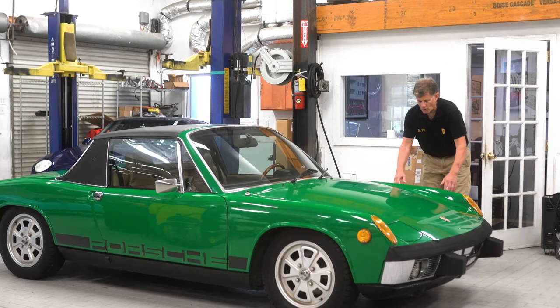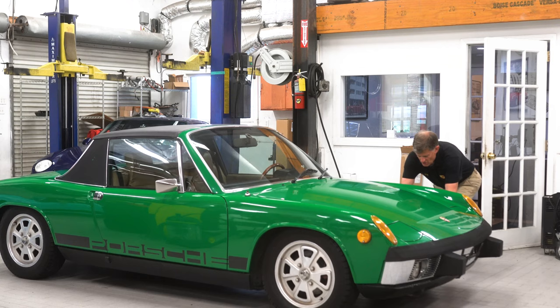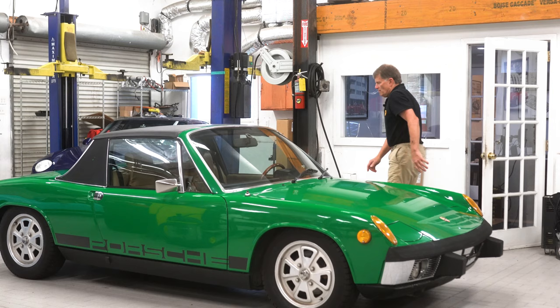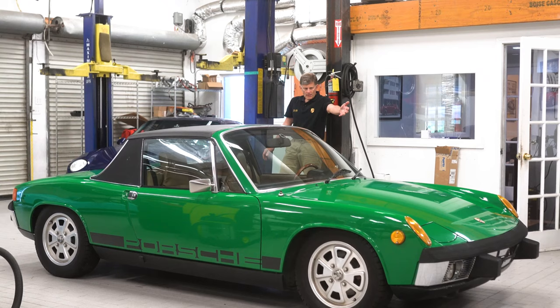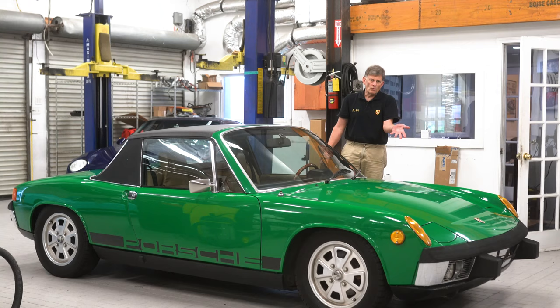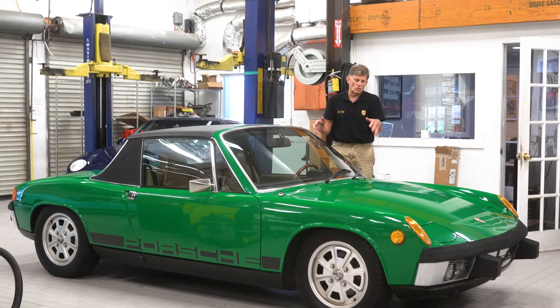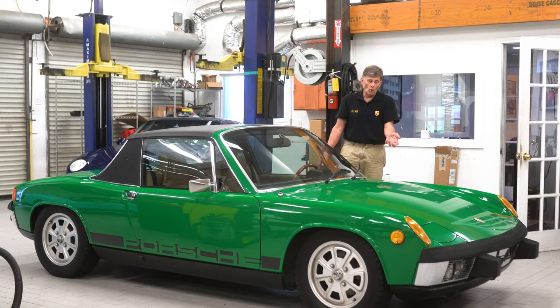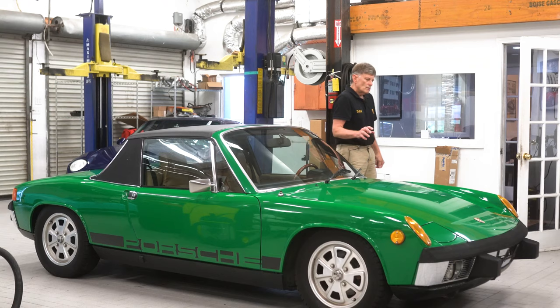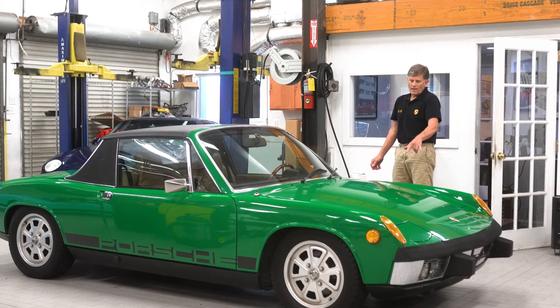I'm going to grab the tire and wiggle it, watching the sidewall flex as well as seeing if there's any wheel bearing play. If there's wheel bearing play, the wheel will knock as you roll it in and out. Then I look at the rake of the car — this car is a little bit lower in the front than the rear. The car should be perfectly even; you can put a level in the door jamb and watch the bubble. If it's too low in the front, it's going to bump steer, shaking the wheel every time you hit a bump. The front adjustment is easy — just turn the bolt at the back of the torsion bar to raise the car, then recheck left and right height. Factory specs are in the Tech Tips book.